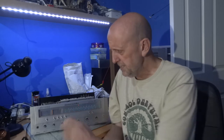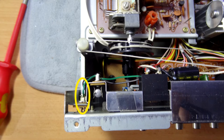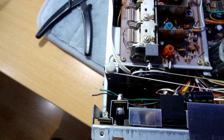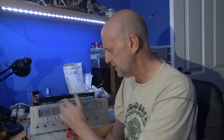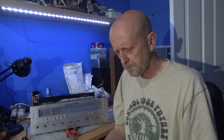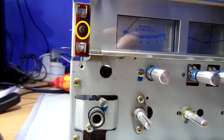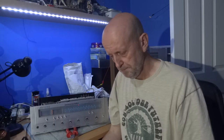Now inside — it's easy to undo these two wires here to give you a little bit more space later on. So we need to unsolder these two wires; you can unclip or unsolder them, whichever way you feel is easier. Those two wires are off as shown. Looking down at it — it's on the left-hand side as you face it. Anyway, that's the two wires undone. Now we need to undo this screw here, and this will take that plate — the little housing bracket the bulb sits in — completely out. That'll help later on, so that's it out.